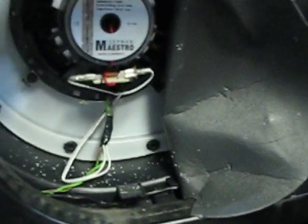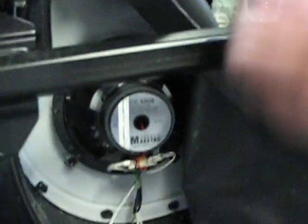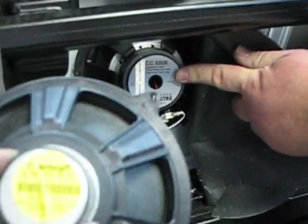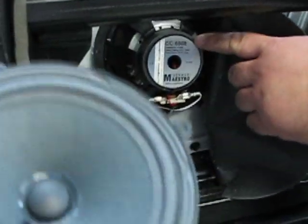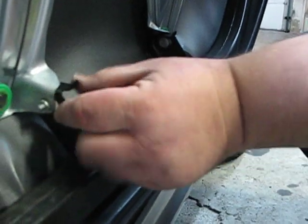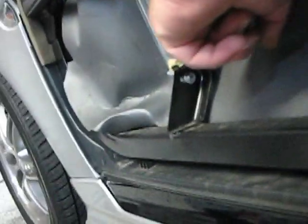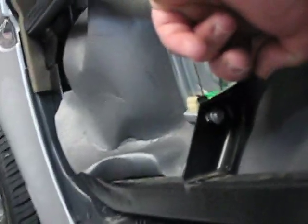Make sure you don't get the two bigger speakers — they're going to touch the window right here. Even these speakers, bought specifically for this car from Germany, are going to hit the glass. The glass still touches the magnet. We had to loosen this screw here, move it out just an eighth of an inch, loosen the screw, pull it out an eighth of an inch, then tighten it back up, and you'll have all the clearance you need.